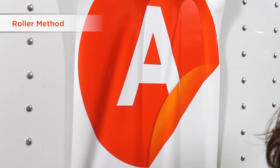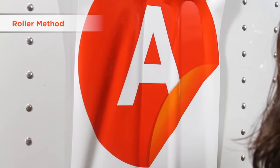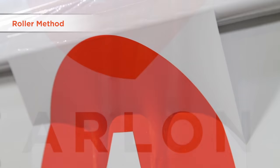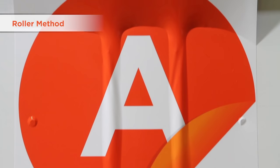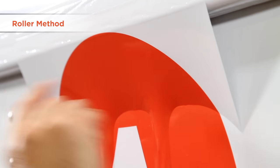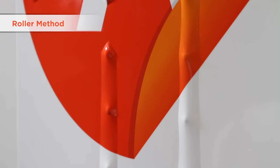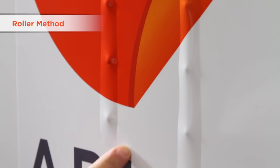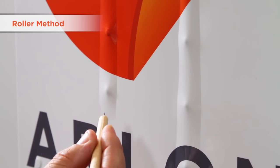Begin by installing the vinyl between the rows of rivets, leaving a vent over the line of rivets that begins at the bottom of the trailer and continues unbroken to the top of the trailer. The vent should be a consistent 1 inch wide at most. The top aluminum rail creates a natural horizontal vent which allows the air to escape in either direction. It's critical that this vent is unbroken from bottom to top. If the vent collapses by accident, you will need to poke a hole in the vinyl to release the air, but don't make the hole near a rivet.